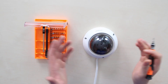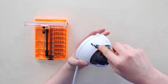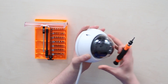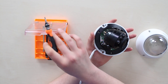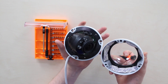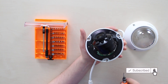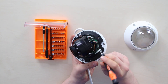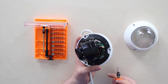With dome-type body cameras, this button is usually hidden inside of the body, but it's not hard to get inside either. Find your camera's box and with high probability you will find there a proper screwdriver to get inside the camera body. You can see I'm using one from the kit I got from iMo. We've got three screws holding the upper part on the base, so let's unscrew it to reveal the board. Now you've got to inspect that board on the bottom to find a similar reset button — here it is. I can even click it and you can hear the sound. Inspect your camera's board with all the functional parts to find a similar button.